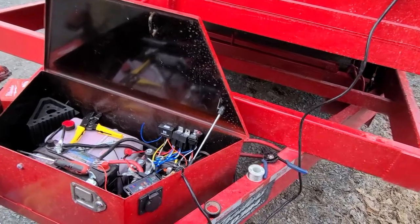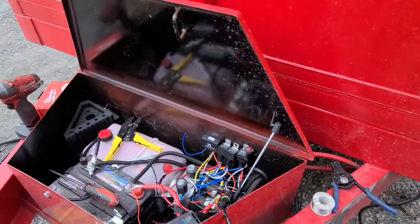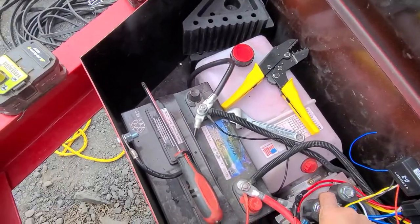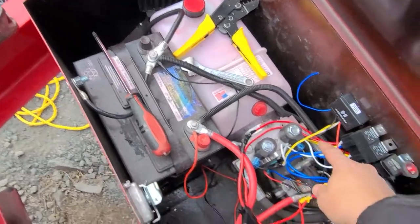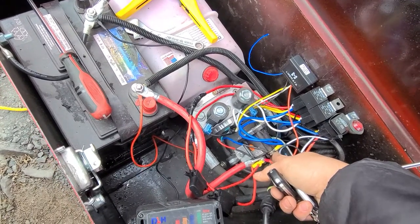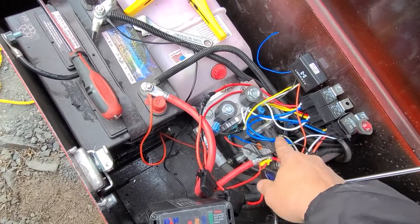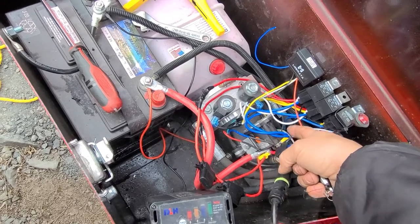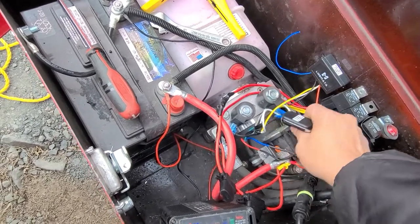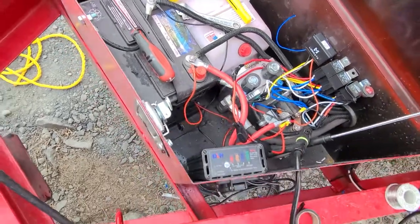This is without diodes — you don't need diodes. The diodes are for if you're using the yellow and the white on this side; they will conflict. The diode lets power go one way but not the other way. So instead of confusing yourself with all that, just do it like this — instead of putting the power from the relay to these two, you run it straight to here because they won't conflict each other. So that's it, it's connected — like and subscribe.